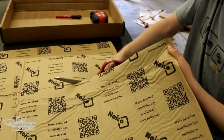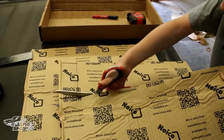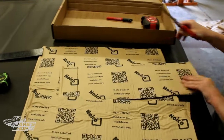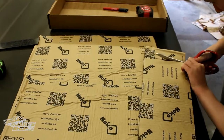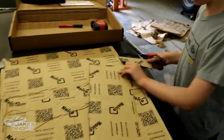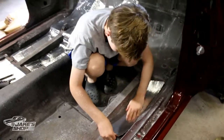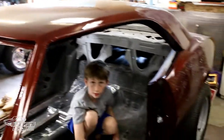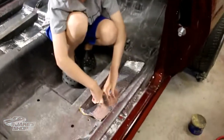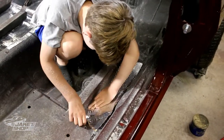I'm not sure how using a knife would be — when we were using the knife earlier it gets a little gummy. It's doable but the blade gets stuff in it. Alright, that looks good, let's go put it in. Remember to pre-mold it a little bit with just a little bit of heat. Get the edge down in the hole, get it along that subframe connector nice and tight — that's where we probably want to start it.